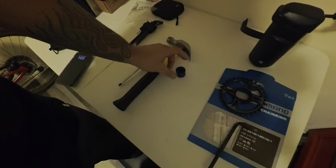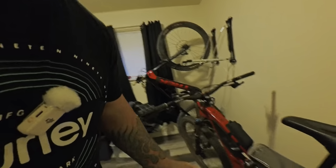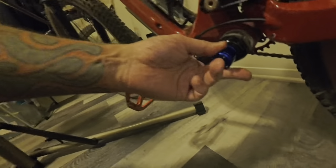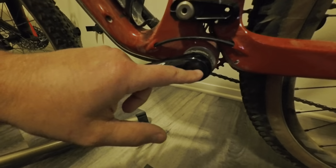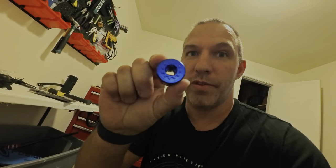First thing — you may have seen this tool on Amazon. It's got some crazy shapes to it, made to lock into the chainring. See, it locks in nice and neat. Do not buy this tool. This tool is awful. I don't know why they sell it. How these cranks come off is via this extractor screw — you put the allen key in here, unscrew it, and that piece with the crazy shape is what actually pulls the crank off. You never remove that piece. In my opinion they shouldn't even sell the Amazon tool — there's no use for it. If you have to take that piece off, your cranks are shot.